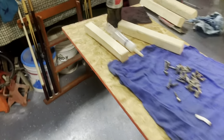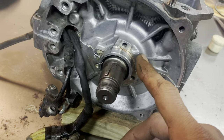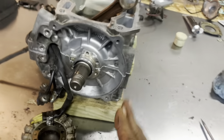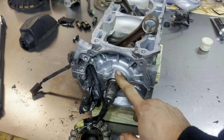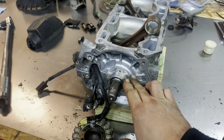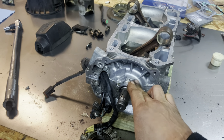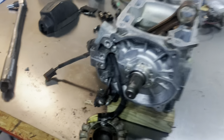Tim had an idea — we're not certain this is the way you're supposed to do it because we don't have a book, but we're thinking about putting Isoflex grease inside here. The only concern with that is if you pack it inside there with the syringe, you might get it inside the threads and then the Loctite wouldn't hold together. These have to be red Loctited because they will vibrate out.